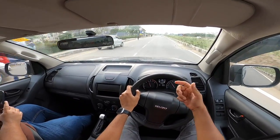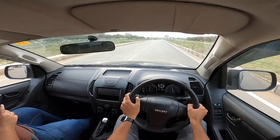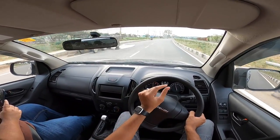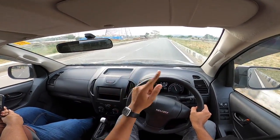And the good news is that, because obviously it has so much grunt in terms of torque, you can go to higher gear at lower speeds. In third gear, it will almost not reach 100 kilometers per hour. It's hovering around 99.47 kilometers per hour. So it kind of falls short in that regard. Now, power has increased by 13 horsepower, torque by 10 Newton meters.